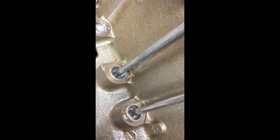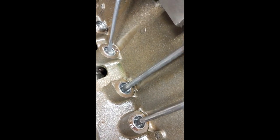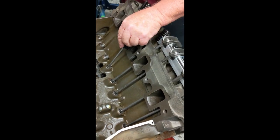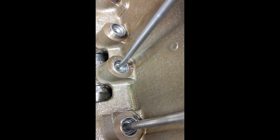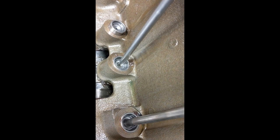If you assemble one and the plunger is right up against the clip and it isn't pushing it down, you'll need longer pushrods. I'd say a minimum of about 40 thousandths down is good. But watch how much travel is on this lifter here — that's a quarter inch or better. So as long as you're off the clip — say that much and anywhere in between — you don't want it bottomed. That's for sure.